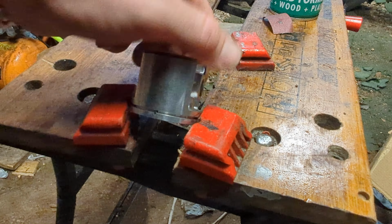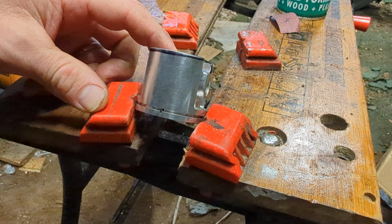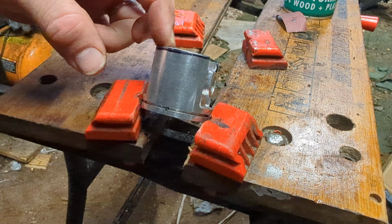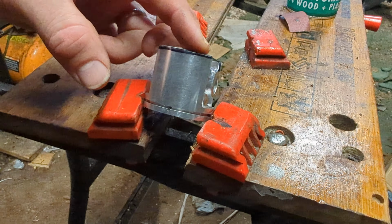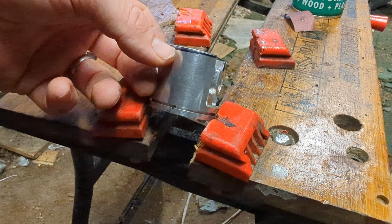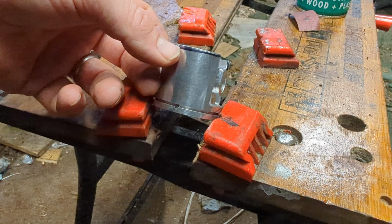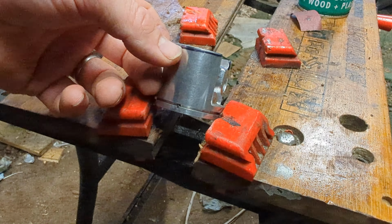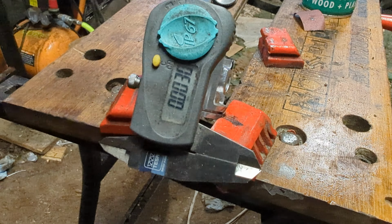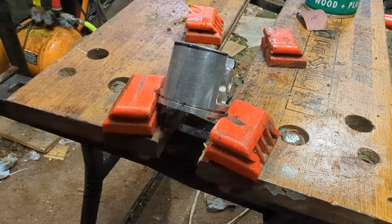Another thing I do, rather than changing the intake timing on the cylinder too much, another trick you can do is take a little bit off the skirt of the piston. So I've just measured the line. You can't see it. The marker pen is there just to show a mark, but just where my nail is, there's a very thin line which I've scribed with my verniers, just by dragging them across like that.